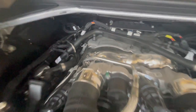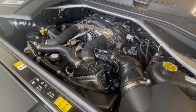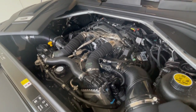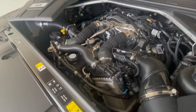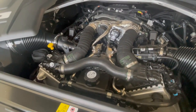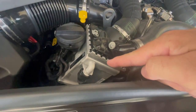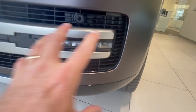Here's the star of the show. We took the 4.4 liter V8 engine from BMW — it's a twin turbo — and you can see the turbos on the back of the engine here. What we've done is added ceramic bearings as well as water cooling and Valvetronic variable intake lifts. That almost eliminates turbo lag completely and makes it nearly unnoticeable. This one has a zero to 62 miles per hour time of 4.6 seconds.